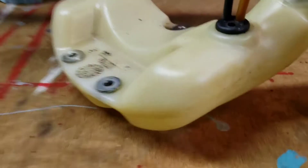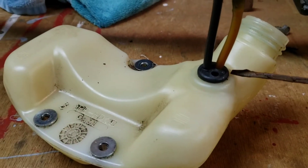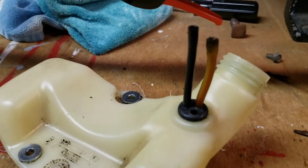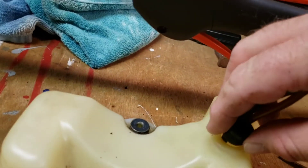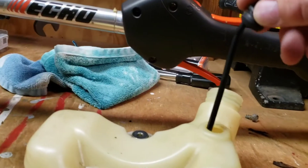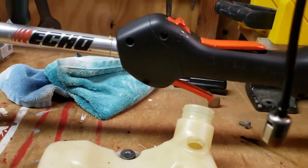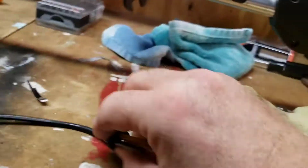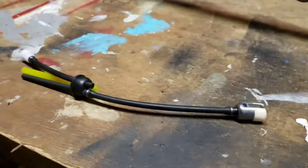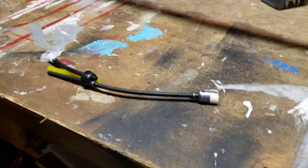While the carburetor cleaner is drying, I'm picking the grommet out with a flat head screwdriver, working all the way around it. Then I'm just pulling the whole thing out with the filter. There's the filter — I don't think I've ever changed that. And here's the new part — all nice, came all in one piece, which is great.